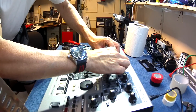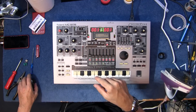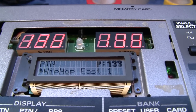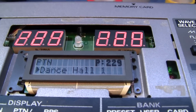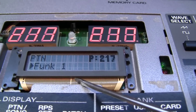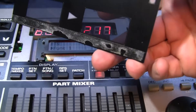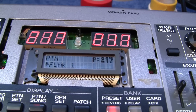Let's see if that makes any difference. Oh, there you have it — let me bring the camera down and show you what's happened. So there you go, it's readable again. Yeah, that's fixed it basically. There are some slight lines that don't seem to light up too well, but it's completely readable. And that's just fixed by running an iron on the back of this striped connector along here. You don't have to disconnect the entire machine to do that — all you have to do is pull this piece up off the front, then a little bit of sticky tape and push it back down again afterwards. Right, I'll finish off putting it all together now and just test the sounds.